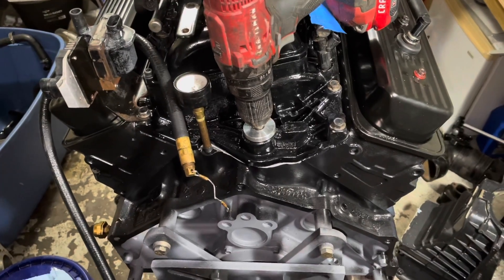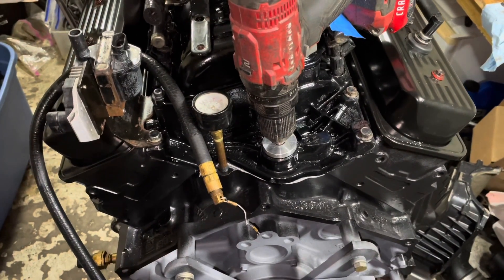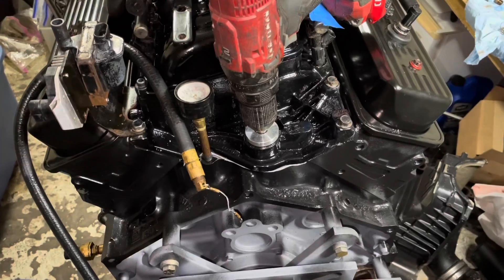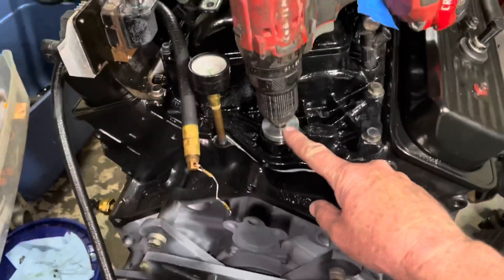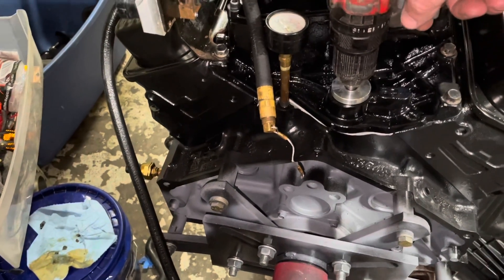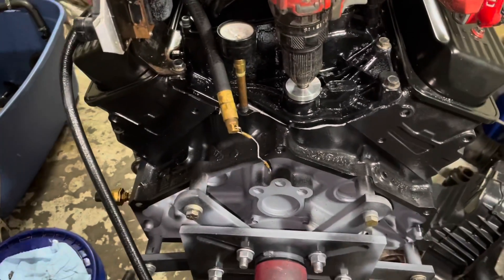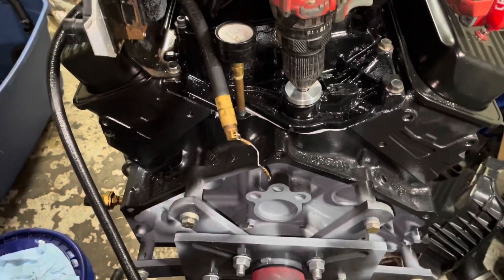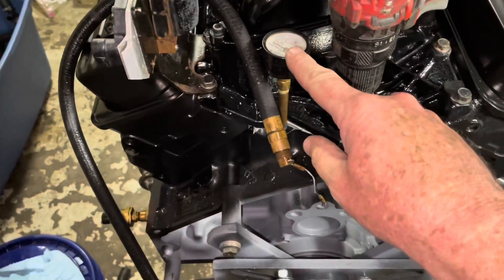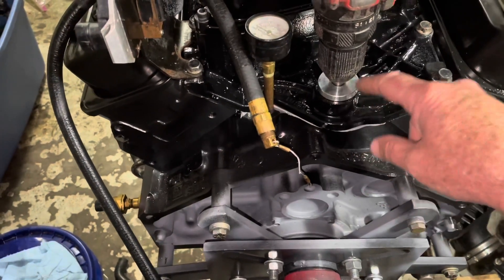Hello, welcome to the Moccasin Marine YouTube channel. In this video I am building a 5.0 liter multi-port fuel injection engine. I'm at the stage now where I'm priming the oil system. I've got this oil priming tool — it's a Proform, I don't remember the part number, I'll put it in the description. It's a tool that uses a drill, and the other end mates with the oil pump down in the engine. As you spin it clockwise with the drill it'll build up oil pressure using the pump inside the motor, and you can't get the pressure unless you use a special tool.